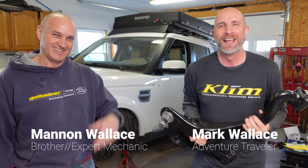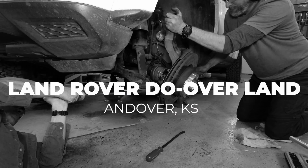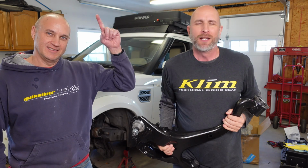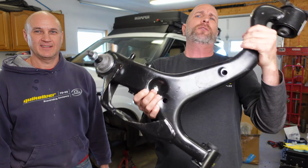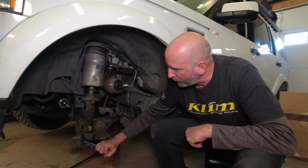This is my brother Mannon Wallace, and we are finishing, hopefully today, the repair that has been taking way too long. If you're not up to speed on what's been happening, you can click this little card right above Mannon's head. But finally, the parts have arrived. This took about 10 days for these bad boys to come in because it's Thanksgiving. So we are about to replace these lower control arms and then hopefully get the entire front end finished off to the dealer for alignment, and then everything should be fixed and hopefully the front end wheel wobble is gone. The first thing we're going to do is take the old lower control arm off.